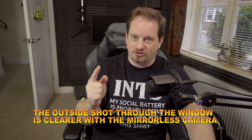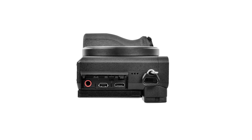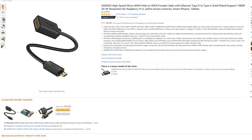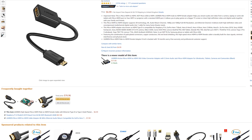Webcams are notoriously terrible at doing this. You must make sure that your camera will display a clean HDMI signal — that means when you output via the HDMI port, it doesn't have all the information dotted around the screen, it's just the video image itself. If your camera has a micro HDMI port, and many, many do, buy yourself a micro HDMI to standard HDMI cable — just a short one — because those ports break so easily. They're notorious for it.